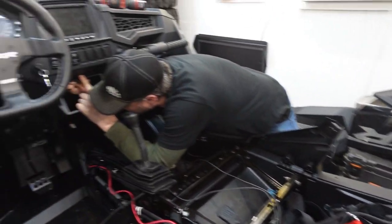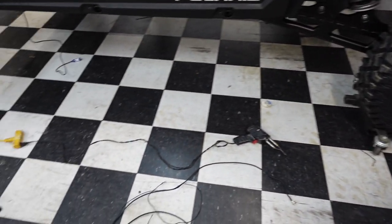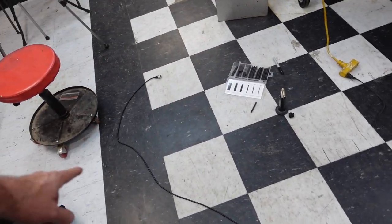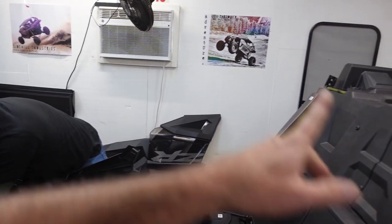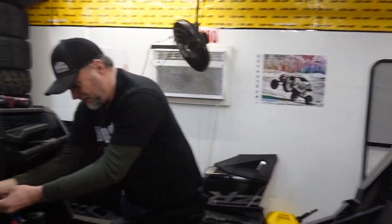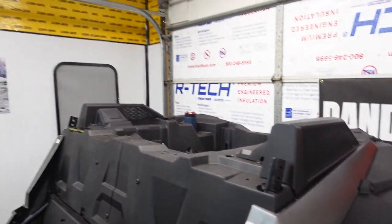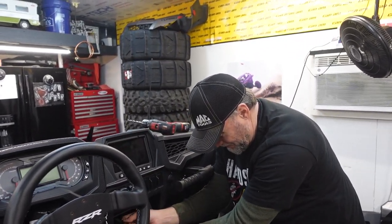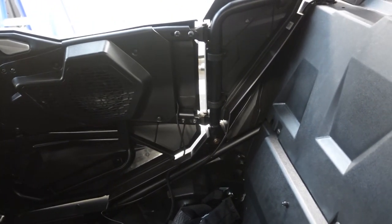We're going to run the antenna now. Keep in mind when you run the antenna cable — this coaxial cable — I already had the ground still on it from our last use. When you run this cable, it can't be looped. Don't loop it up in a circle. If it's too long, reroute it around the car in such a way that uses up all the length. Seriously, don't coil it up.